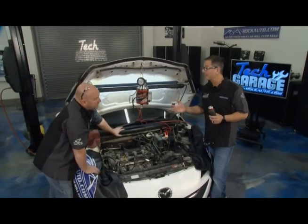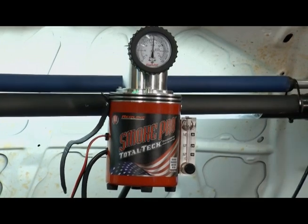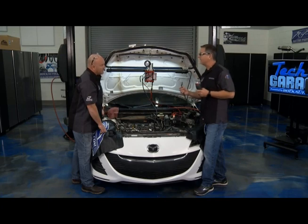Yeah, remember, we got too much air in this car, not enough fuel. So it's time to check a vacuum leak. And what better way to do that with our Smoke Pro Total Tech. This joker puts out a ton of smoke. That's hugely important, especially when we're dealing with vacuum leaks.